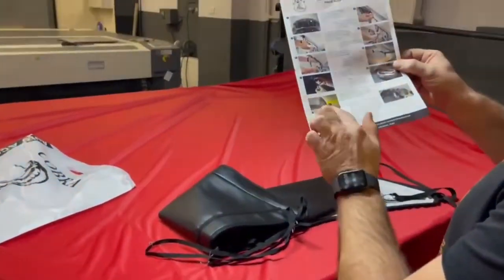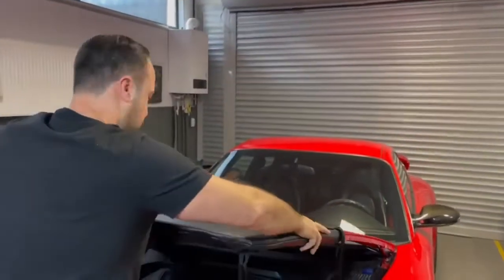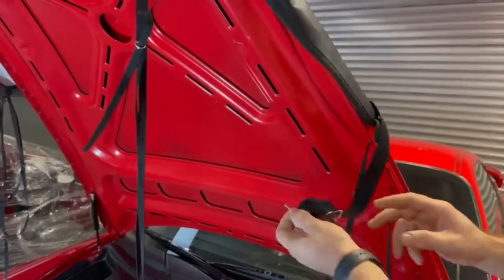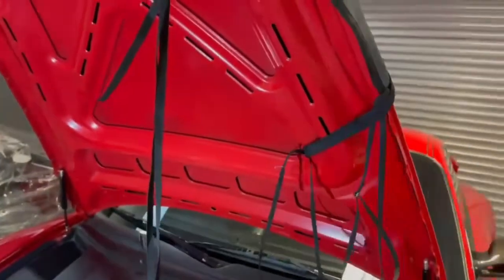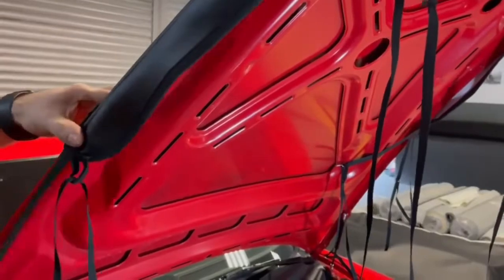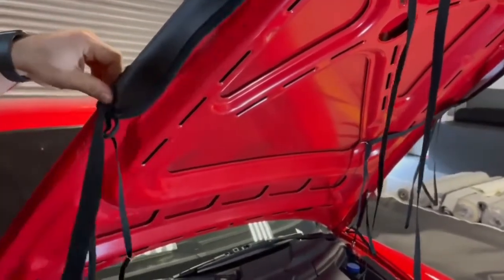Let's go over our installation for defined curved hoods. You will slide the bra onto your hood like a glove and proceed to strapping it down. This strap style runs through the bra horizontally and can be pulled from either end to adjust. Be sure to hook these straps in holes close toward the windshield with the belt remaining flat.